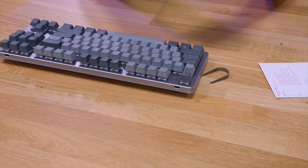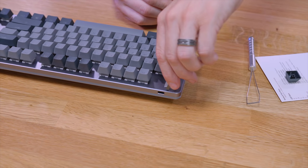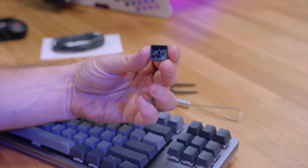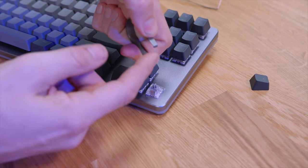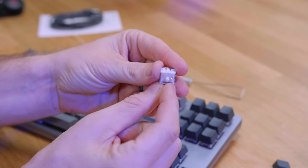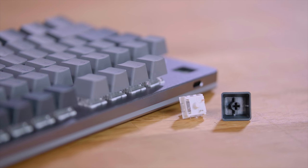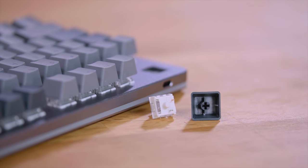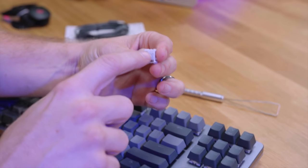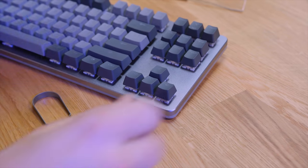Let's go ahead and talk about the switches, because as I mentioned, these are hot swappable. So if you wanted to pull out one of the keys, you could use the key cap puller. I'm going to use Escape since it's easy to access. You take your little switch puller, find where the two grooves are, and you can actually pull it right out. The key caps are Cherry MX style, so if you had a favorite set of key caps you could use them. Massdrop also does key caps from time to time. These are just two contacts that press into place — it only goes one way. So if you had a key switch die on you, you could replace it without having to solder or desolder anything. You can also see inside the switch the LED itself, since this is an RGB keyboard. To reinstall, you just line it up with the two pins on the bottom, push that down, put the key cap back on — and you've just replaced your switch.